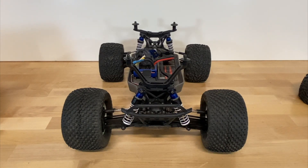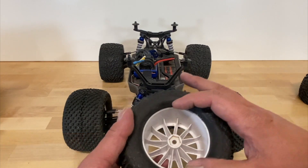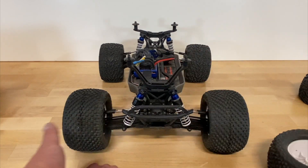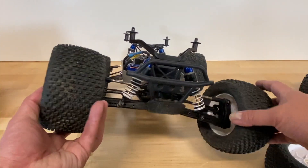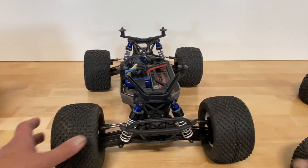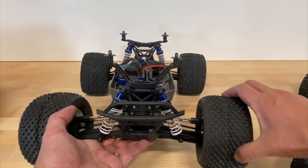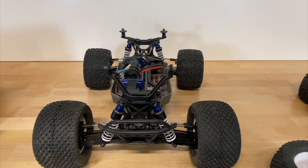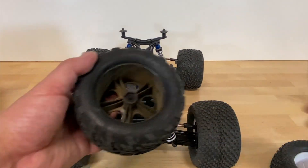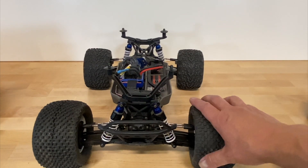Number five: make sure you get the right inner diameter when you buy different wheels and tires. For one-tenth scale trucks there are a couple of different sizes — generally 2.2, 2.8, and possibly 3.8 inch wheels — which is basically the inner diameter. You want the right wheels to actually clear the steering on the front. Most 10th scale Traxxas or Arrma vehicles use 2.8-inch wheels; something larger like a Maxx uses 3.8-inch wheels to clear the knuckles and hubs. Just measure the stock wheels on your vehicle to confirm.